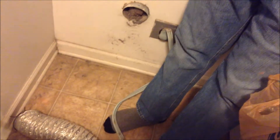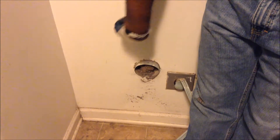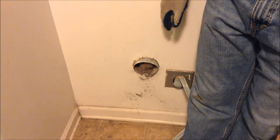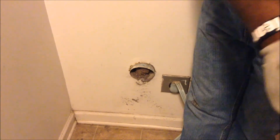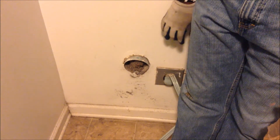Alright, as we expected, we went on the roof and cleaned out the access tunnel where all the lint goes up, and we knocked some of it loose so it fell back down. We came back inside to double-check and clean this out as well. I simply detached the dryer lint tube from the wall and now I'm going to pull all this out, get as much as I can, and use something to reach up a little bit to check the pathway. Once we do this and check the dryer again, it should be drying better — that's what we hope for.